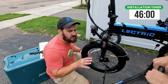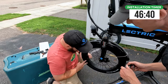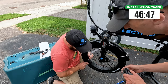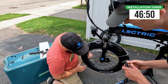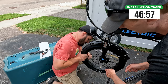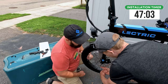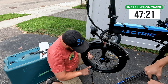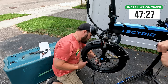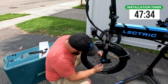We're going to go ahead and pump the front tire up to what we like to ride at, which is somewhere around 30 PSI. One thing that did happen is when pumping up, the tire was a little bit off so it became slightly unseated — that's just from it being uninflated. We let out a little bit of pressure, got the tire nicely lined up on both sides, and pumped it back up. What you want to see all around is the bead line — there are little lines that go the opposite direction, and you want to see similar sizing on both sides all the way around. Then don't forget your little plastic valve caps.